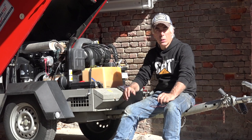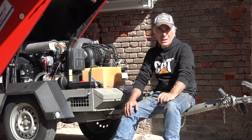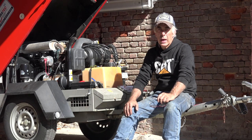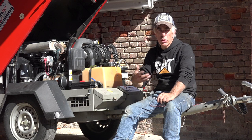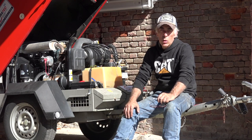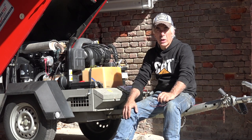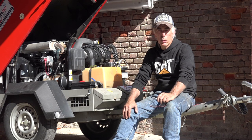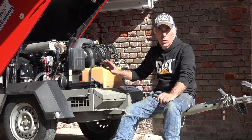And as a last note, you might wonder, should you buy or should you rent this kind of equipment? Well, that depends a bit on your work and how much work you have. Renting is always a pain in the butt, and it's quite expensive as well. I think renting it is around 300-400 euros per day, and a day is 8 running hours on a compressor. You have to go over there, you have to pick it up, and then you do your work and then you drag it back. It's a bit painful, but of course if it's a one-time job, it's not worthwhile buying it. If you do it quite often, and I worked it out, if you do the work about 20 times, then everything is paid off by just going and buying it.